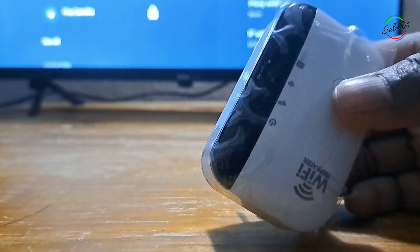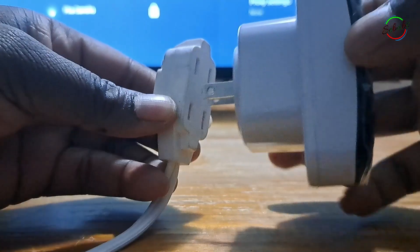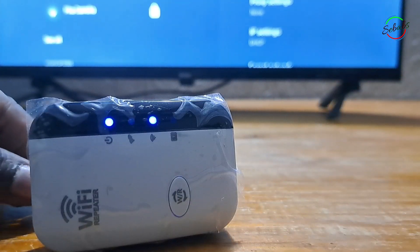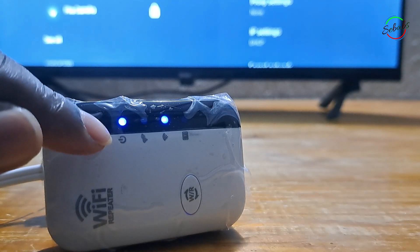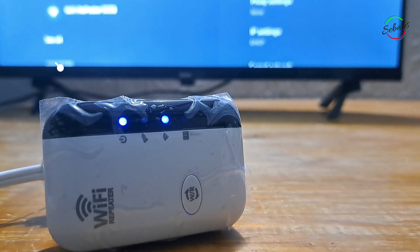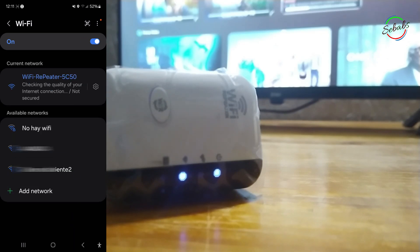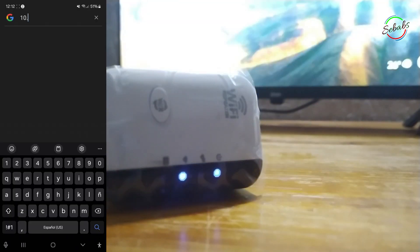You can also log in using your cell phone. We talked about using the laptop — now we can do the same thing using the cell phone. The process is basically the same. You plug your Wi-Fi repeater into a wall socket; in this case you don't need an Ethernet cable. You connect to the repeater's default Wi-Fi network. After you connect, wait a few minutes and you should see two LED lights on the repeater — one for power and the other for Wi-Fi. On your cell phone, click on the repeater's name and the browser automatically loads the setup page. When you click on the repeater's name, you're probably not going to get redirected, so you have to enter the default IP address.